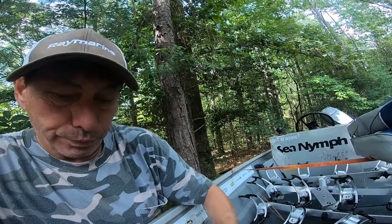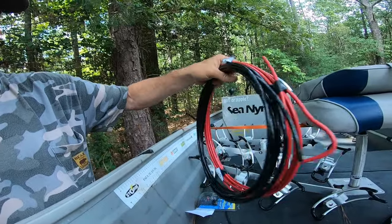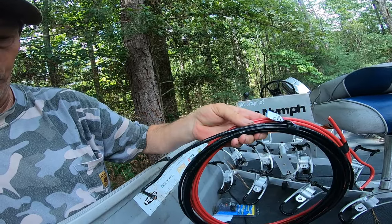The Ultrex is not 12-volt but 24-volt — two batteries hooked up in series to make 24 volts. It draws more amps, so you need the wire gauge to carry those amps. Before I had 10-gauge wire, but they said I need 6-gauge wire, so here I am. I went to Lowe's and got more than enough to do the job.